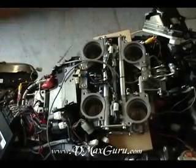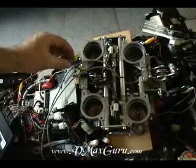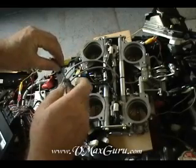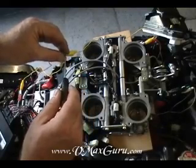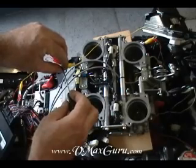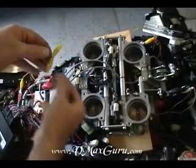Alright, now what I've got here is a potentiometer, and hopefully you can see down into where the throttle bodies are, and I'm going to set the extra opening angle with this pot because I've put it in the circuit. You can see it opening up there. See it open up? So I could put about that much more additional opening angle into it if I wanted to. And when I take it out, it snaps closed because it gives an error.